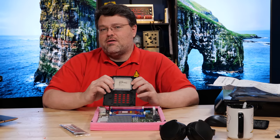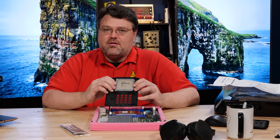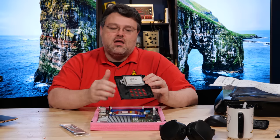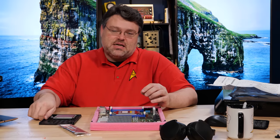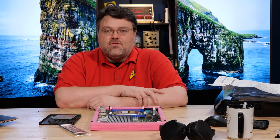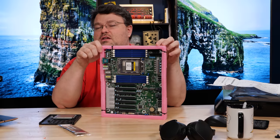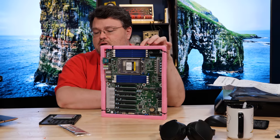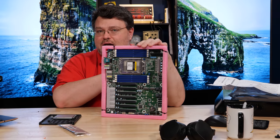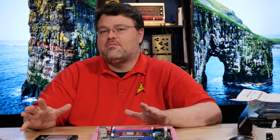The 73F3 has two cores per chiplet sharing 32 megabytes of L3, for 256 megabytes of L3 per CPU. You could run two 72F3s in a dual-socket machine, which opens up a lot more memory capacity since each CPU supports its own memory. From a commodity standpoint, I can fairly easily equip this thing with two terabytes of memory — although I'd probably need a motherboard with two DIMMs per channel instead of one. Two terabytes supported on an eight-core processor is absolutely nuts.